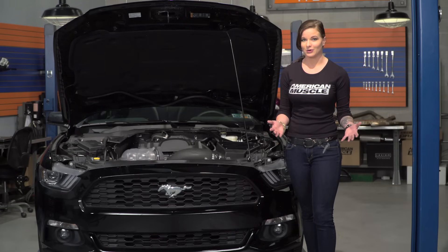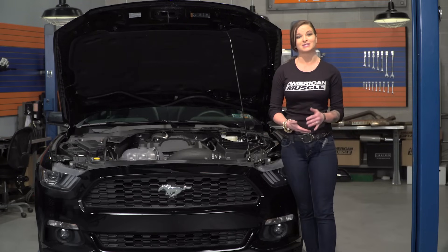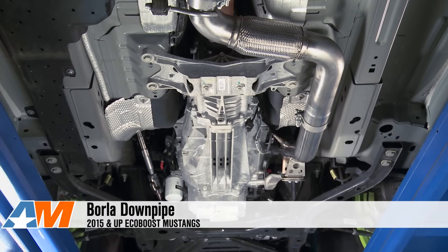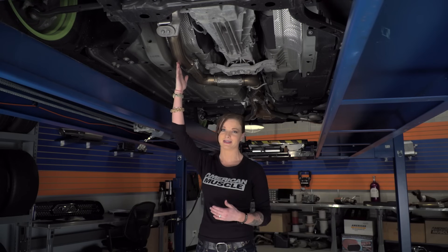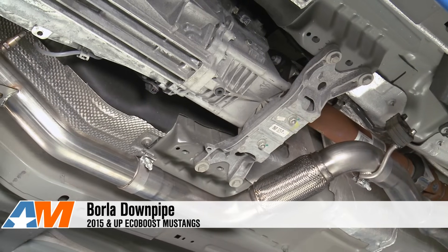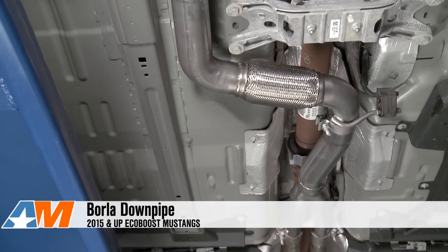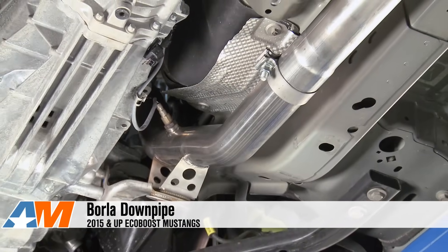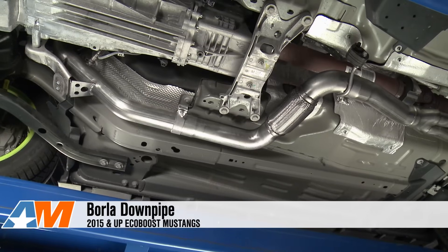That's not all we did — we've got to get the car in the air to show you where we did some of the more serious modding. In the world of turbos, one of the first and most beneficial power mods you can do is get a new downpipe, so that's exactly what we did. The factory downpipe on the EcoBoost is pretty restrictive, so an aftermarket downpipe is for those looking for less restriction, which ultimately means improvements in performance. It can offer a big improvement because it helps the airflow of the turbo, helping you spool the turbo more quickly. This is a three-inch downpipe — an upgrade over stock and one of the only three-inch downpipes available right now.